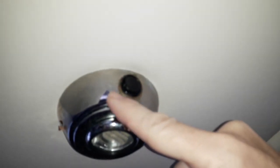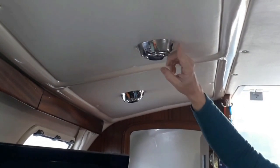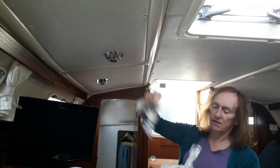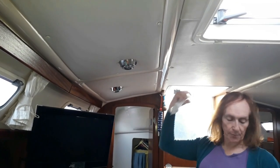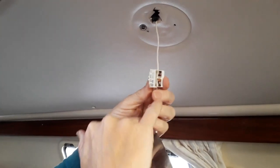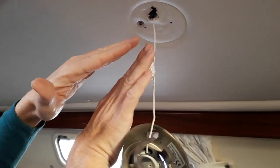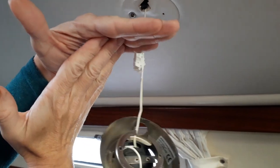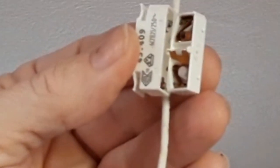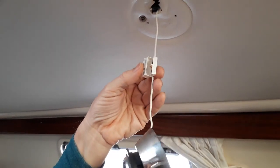This one, as well as being corroded, somebody's had a real pig's ear job of gluing the switch on and the little rocker switch is broken. So this one has a tendency to - as you can see - it's got a bad switch. So I have bought a dozen new switches, a dozen new rockers and a dozen new little surrounds. So this is going to get taken down, refurbished, refixed and put in there. Things are not going according to plan, but that's normal. I've prised this apart and all the insides have fell out, which is not good - it's obviously not meant to be prised apart. There are like two little copper blades that face that way, and I think the idea is you push a wire in and the little copper blade deflects down. Then if you try to pull the wire back, the little blade stops it coming out. These have got special metallic crimps on the end which I think are meant to catch that little copper blade. What I might do is put a little blob of solder on the end and then as it pulls back, the blob of solder would catch. Anyway, we've got to experiment and see what works.